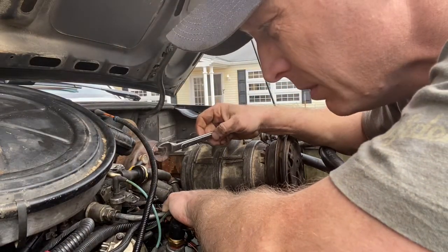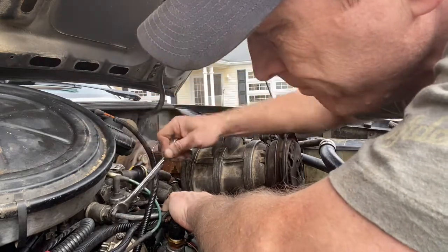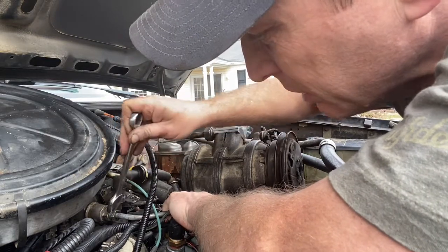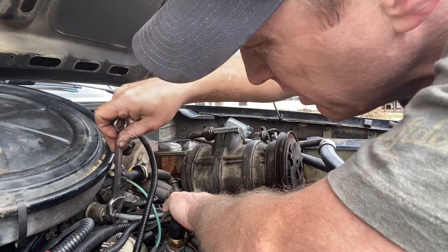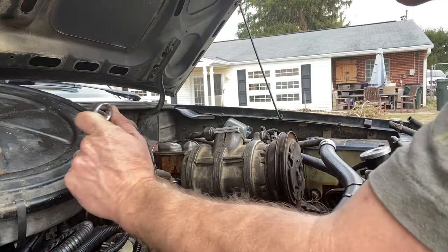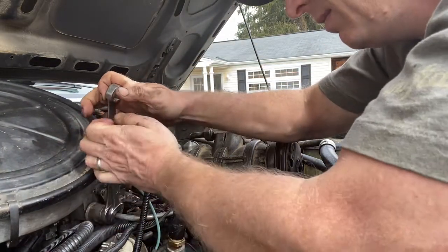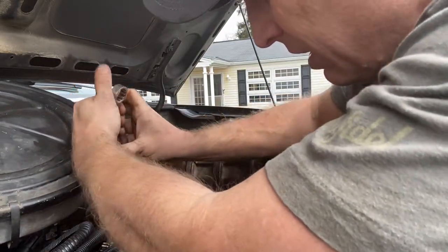I found out when I filled the gas tank up that the O-ring I put back on did not seal. So I do have to pull the bed back and take that lock ring and O-ring back out in a couple days when I get my parts in. It's $10 worth of parts I probably should have bought in the first place. I don't think the silt getting past the filters is clogging anything — I think it's in suspension and it's okay.